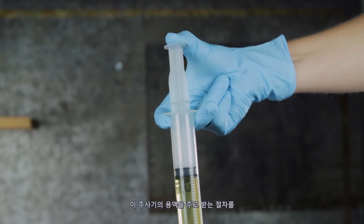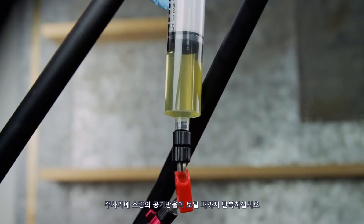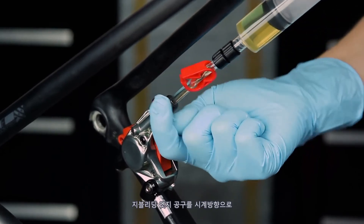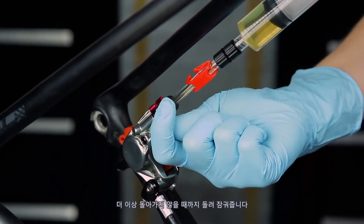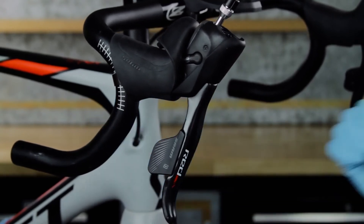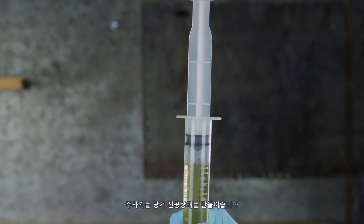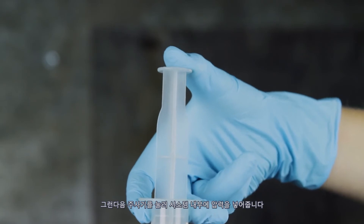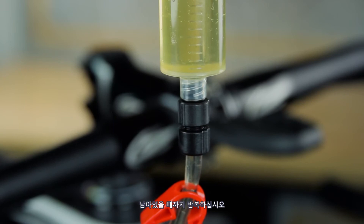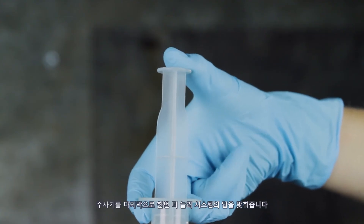Repeat these steps of transferring fluid from one syringe to the other until only a small amount of bubbles appear in the syringes. Rotate the bleeding edge tool attachment clockwise until it stops to close the system. Squeeze and release the lever blade. Hold the syringe at the lever vertically, firmly pull up on the plunger to create a vacuum, then compress the plunger to pressurize the system. Repeat these steps several times until only a small amount of bubbles exit the system. Compress and release the plunger once more to equalize the system.